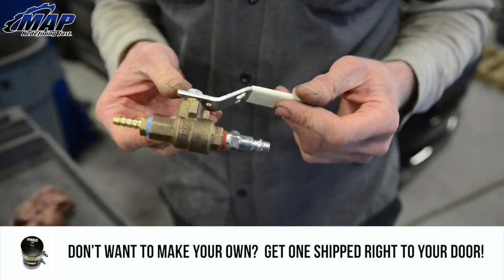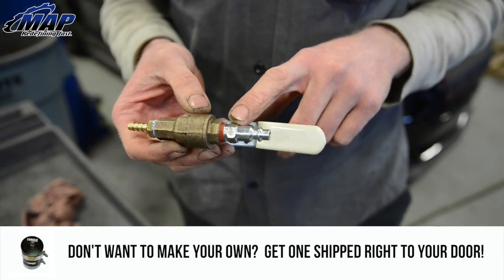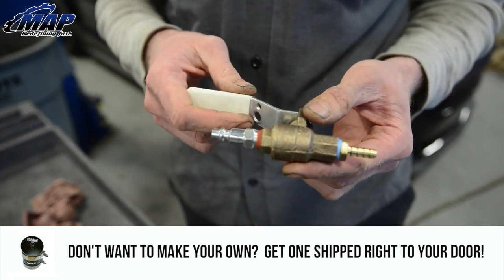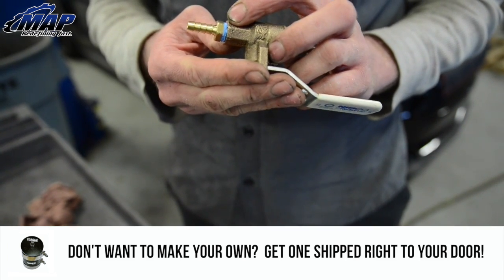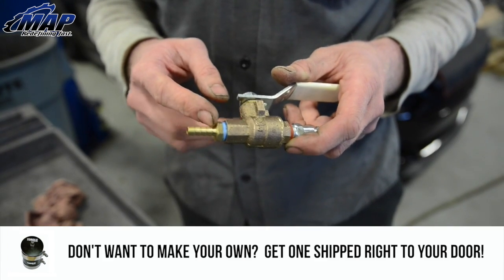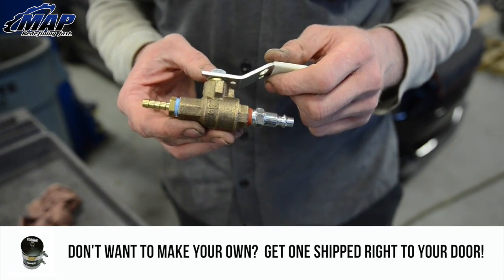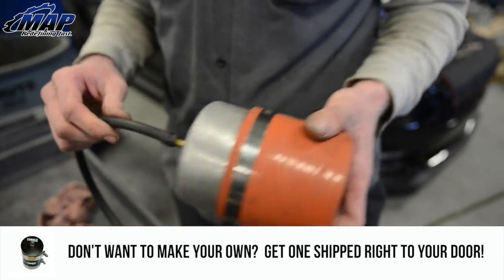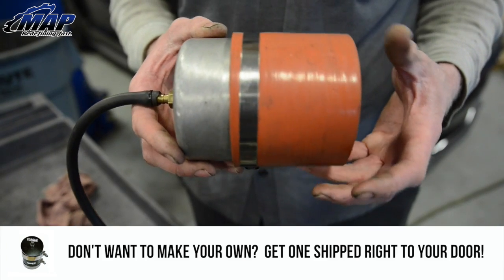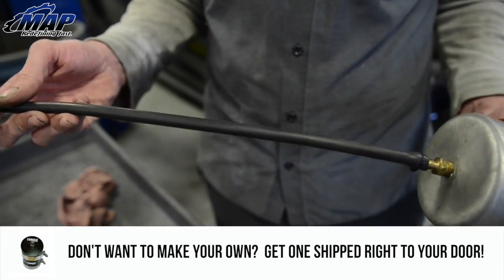We made our own boost pressure tester. All three of these pieces you can get at Menards or your local hardware store. Here we have our air fitting end, which is quarter inch. Then we have the actual shutoff valve itself, which is a quarter inch female-female brass shutoff valve, and then here we have a brass quarter inch to barb fitting. This fitting came with thread tape already on it; this one did not, so we added our own. Basically just want to make sure you test the valve beforehand to make sure none of these fittings are leaking, as this creates more noise and makes it harder to find the boost leak. This piece of pipe is aluminum, tapped for another barbed fitting, and then we just put our hose coupler on it. You can also use PVC pipe — anything you can find that works, as long as it can seal and be airtight. Then vacuum line and you're good to go.